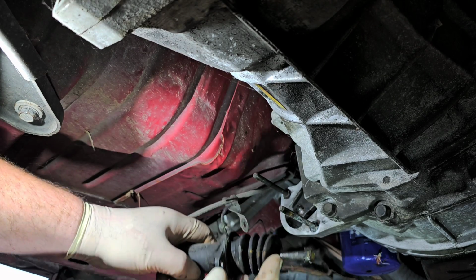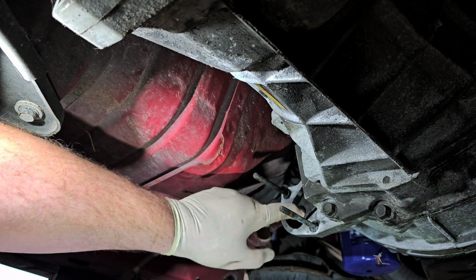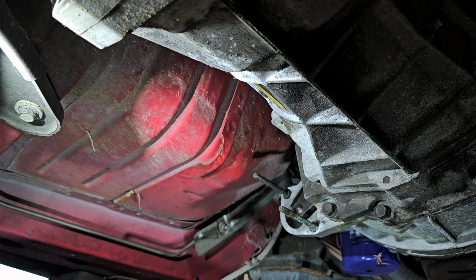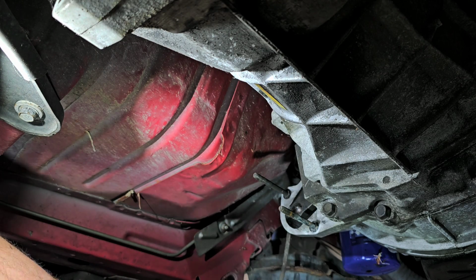When you step on the clutch, this piece pushes out. When it pushes out, it pushes against this piece here, which is the clutch fork. You remember me talking about when I was showing you the Ford Escort? This is that clutch fork that gets depressed, and it presses up against the clutch to release it.